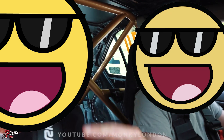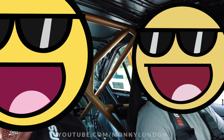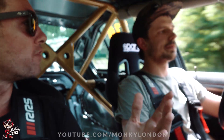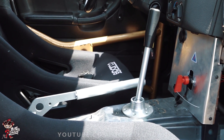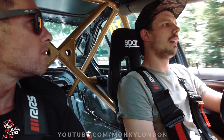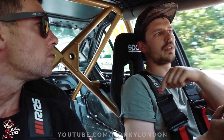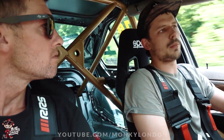This is sick everyone. This is a really sick car, man. As long as the map's good and the cooling's decent, it's quite a bulletproof engine - quite a strong, reliable engine for that kind of power. What about the gearbox? Is it a stock 325 gearbox? No, this is a ZF - 2.8. And the diff? It's a stock 325 one, welded. I've got another one with a shorter gear ratio but this one drives better. If you do a very small circuit you can swap to the other diff. What about the arms and bushes - adjustable camber arms and stuff? Yes, adjustable camber arms on the rear, and polybushes all around. Strong flex - Jamie K, baby.